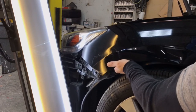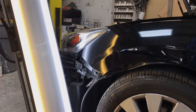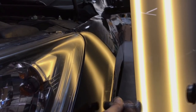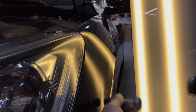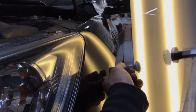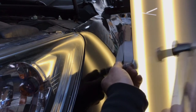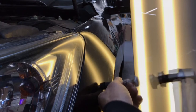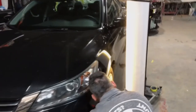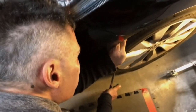You can see my tool up above on that body line. Now I'm going to do some more buckle work and crown work, throttling up and throttling down on that crown, taking down layers. I'm using the neoprene tip — you can see how the metal is laying down real nice after I got that body line out. I'm going in and doing some more cleanup work, going back and forth on each side. I'm finishing up — almost done.